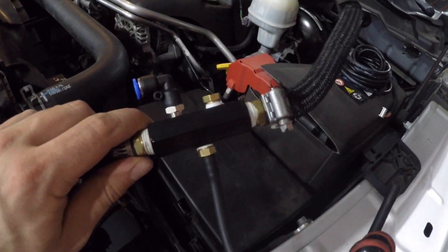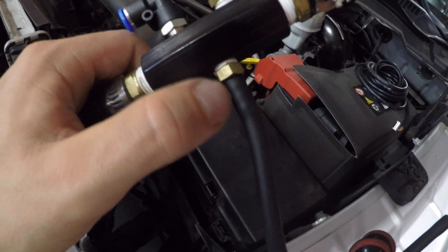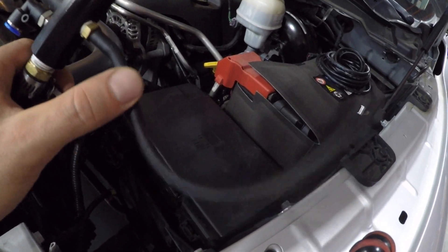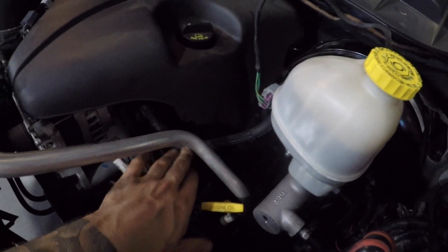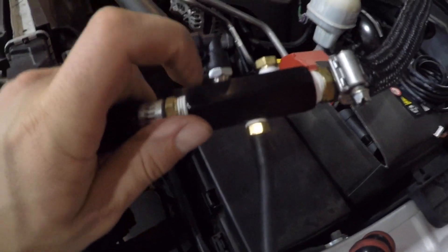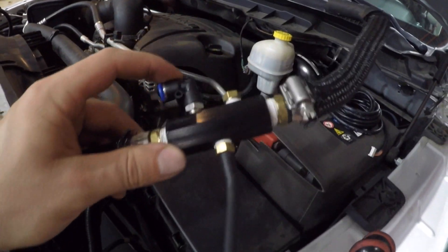This manifold vacuum block will have our line with a push-to-connect fitting, and we're gonna do away with one port later — for now we'll put a plug in it. This line will eventually run to the bypass valve for the supercharger. We can run a boost gauge even though we don't have boost yet. The vacuum line we need to replace is the one off the brake booster. Since the supercharger kit is used, the previous owner already included his cut brake booster line, which saves me some work.